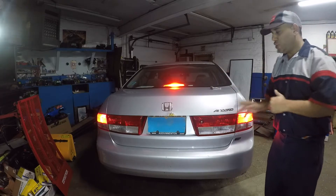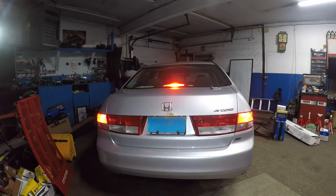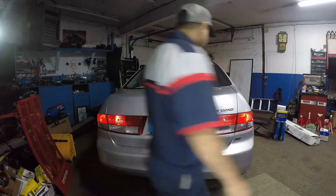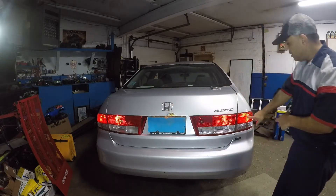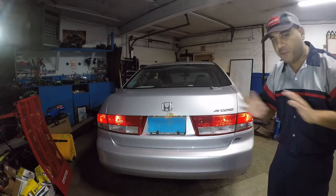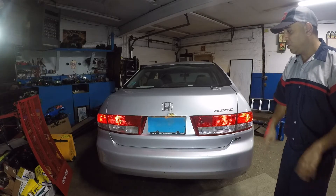I made a little mistake because I was confused with another car. Let me turn off the brakes and put on regular headlights. There we have it — regular headlights. So when you put on your headlight, this bulb turns on, this bulb turns on, that bulb turns on, and that bulb turns on. When you press the brakes these get brighter, so this is a dual filament bulb. You do need to put in the correct bulb — if you put a wrong bulb in, you're going to blow fuses. Any connector that has three wires is a dual filament bulb.